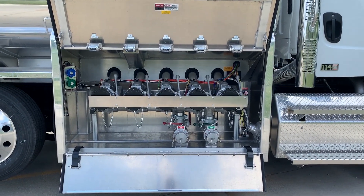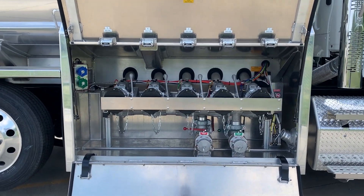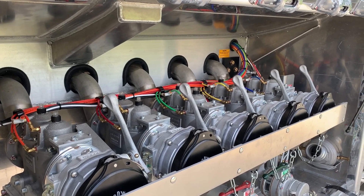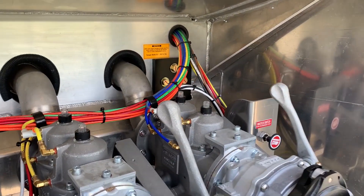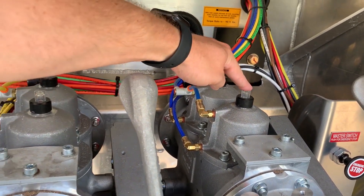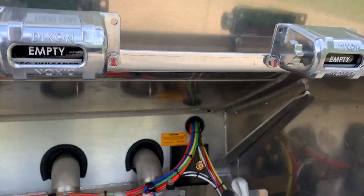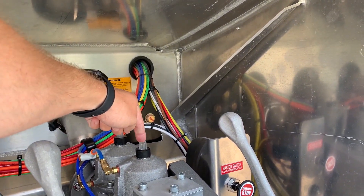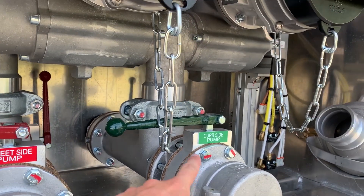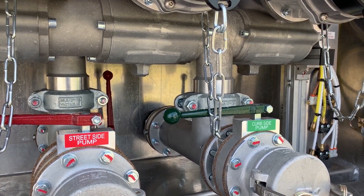Looking at the side of the truck, you can see the manifold along with the bottom loading, overfill, and gravity drops. This is a 3-inch dual bank air manifold — it uses air to open the two valves, one for each side of the manifold. In our scenario, compartment one comes down here, the toggle switch opens the valve directing it to this side of the manifold, and from there it goes down to the curbside pump. From the curbside pump it shoots back to the meter and hose reel at the rear of the truck.